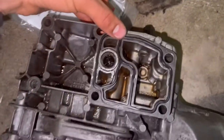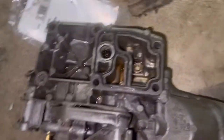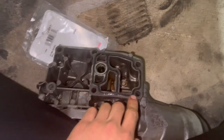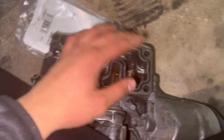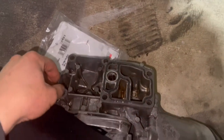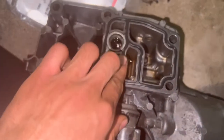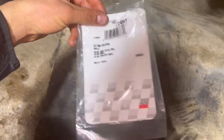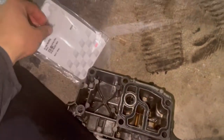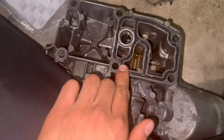Make sure she's in nice and snug. Once you've got it sealed up, you're ready to start putting it in. I'd probably start from the top just so it gets a nice tight seal — you don't want this thing slipping out. When you start putting the bolts in, start from the top and work your way down, or you can do a star pattern. I picked this gasket up at AutoZone — it isn't the cheapest, but I wanted to get this done today. If you want a cheaper option, Rock Auto has pretty cheap OEM ones too.